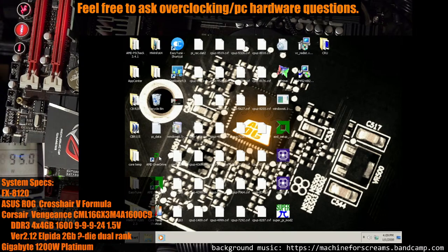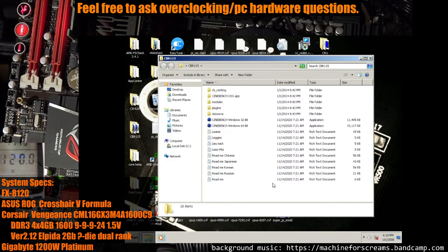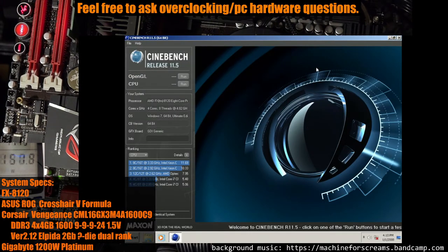On LN2, it gets worse, though. Actually, on LN2, the spread between various cores on one FX chip can be 500 megahertz. I have an FX9590 where there's one module on the entire chip that does 8.34, and all the other modules are 8 or less. That's where this validation file comes from. 8.343 gigahertz. And that's one core in one module that does that.